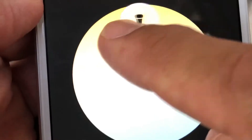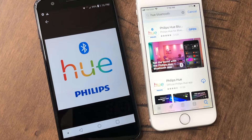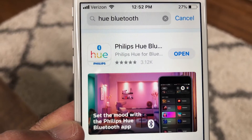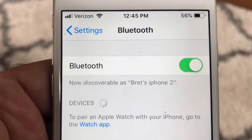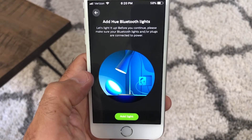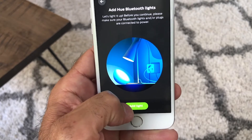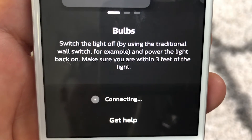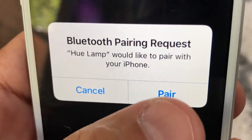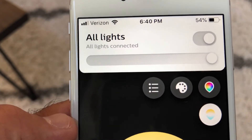With the Philips Hue light bulb, you can control your lights with your phone or tablet. For this particular Bluetooth device you need an app — it's a free app called Philips Bluetooth and you can download it from either the Apple or Android store. Before you open the app, make sure Bluetooth is enabled on your phone or tablet. Inside the app, it will remind you to make sure your Bluetooth light bulbs are installed and powered up. Then to get connected, put the light bulb in your lamp and power cycle it: turn the light on, turn it off, then turn it back on. This makes the light bulb discoverable so your phone or tablet can talk to it, and the pairing process begins.